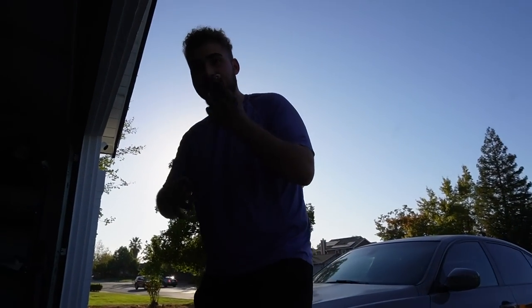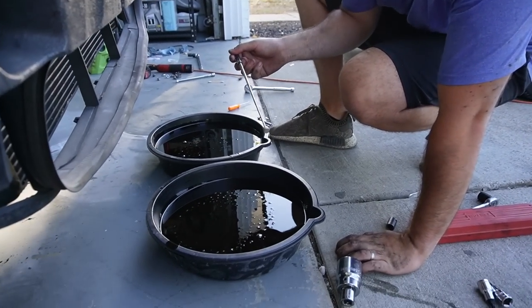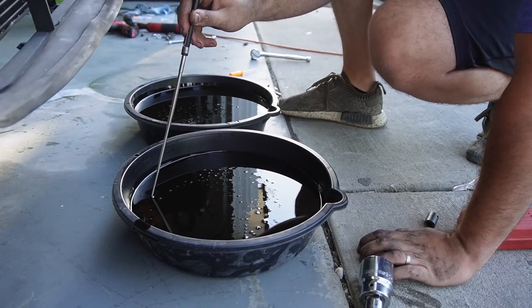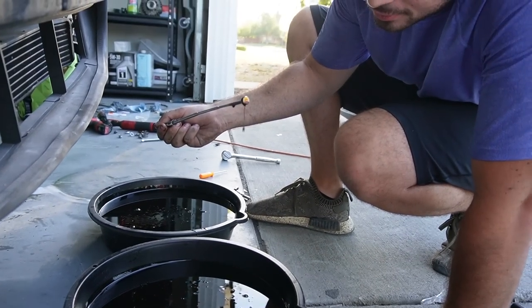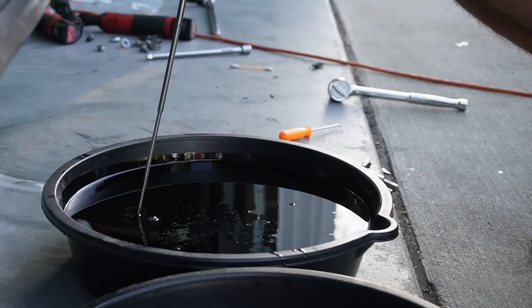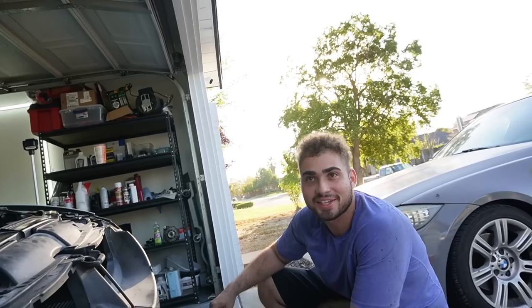Moment of truth - I've got a magnet right over here. This is stressing me out. I'm hoping the rod bearings have been done and we won't see much, but I don't know what to expect. I tried both sides and I don't see anything - no metal shavings at all. Theoretically it should pick up metal shavings, but literally nothing. That's good, that's really good. I guess there's nothing else to do but start this thing - I'll put oil in it.